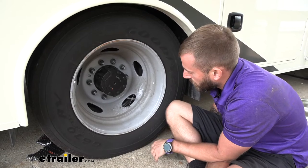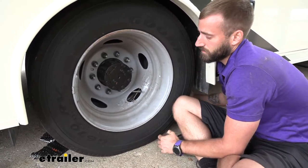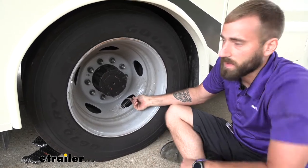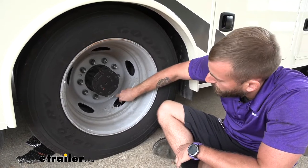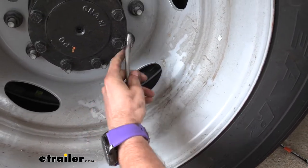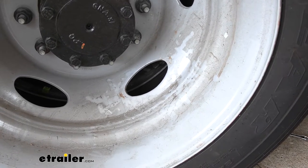So we'll first have to remove our little extender we have on here already. There are a couple of ways you can get your old valve extender off — you can reach in through the hand holes if there's enough room, or you can get under there and behind the wheel to get a little bit of access, because we are going to need a wrench to get this off. It is kind of a struggle and hard to really show, but I've got it started, and I was able to just twist that off. Luckily we didn't need our wrench — I was able to grip it enough to get it broken off of that valve stem.